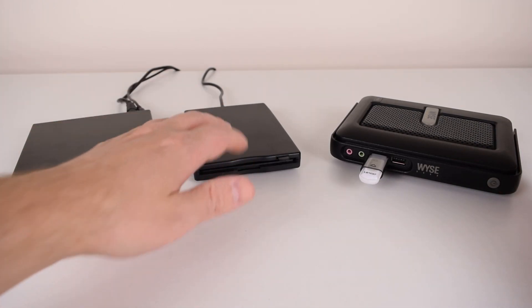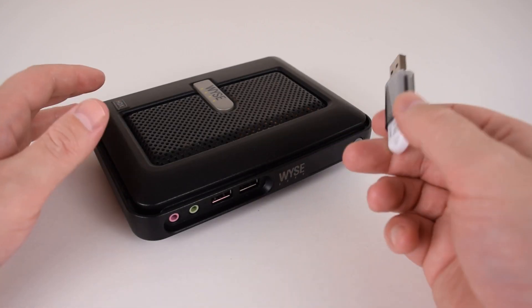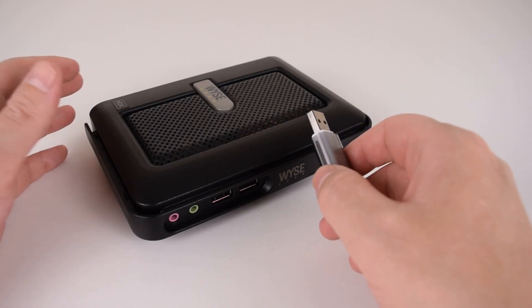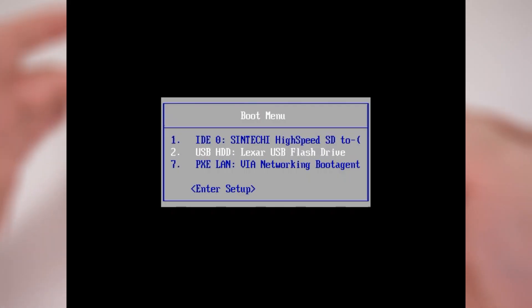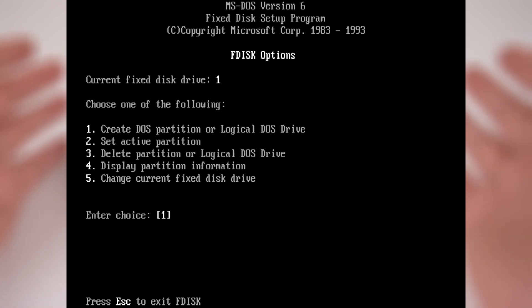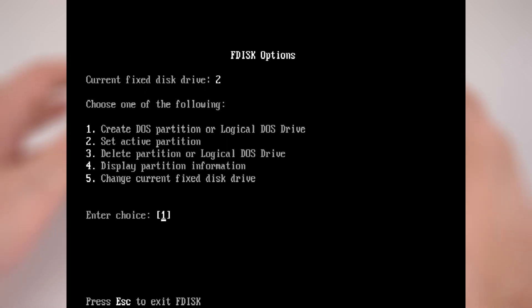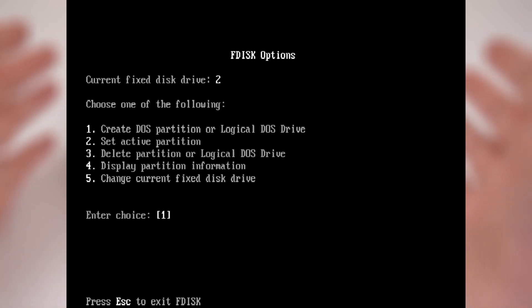The machine has excellent USB booting support — USB optical drives, USB floppy drives, and thumb drives all work just fine. The USB flash drive also works great under MS-DOS as a hard drive. The internal storage is your C drive, but if you plug a flash drive into the USB it becomes your D drive, so you just partition and format it from within DOS and you can then transfer data really conveniently between the thin client and your modern desktop.